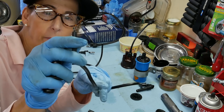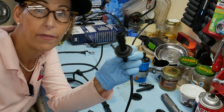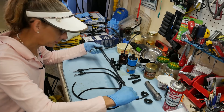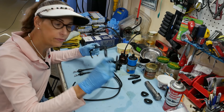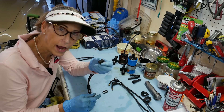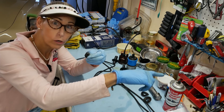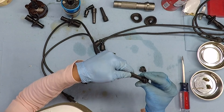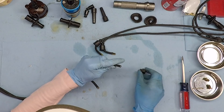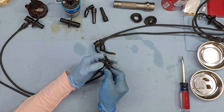We need to add the two little rubber gaskets and the connector as well, so I have to put them on from this end. When this was sitting in the shroud on the engine, the top one was cylinder number one — the longer wire of the two — so I'm going to put it back together that way. We need to put our two O-rings on first because they need to go on ahead of it. Looks like the longer one will be on top and the shorter one on the bottom.